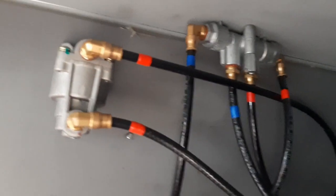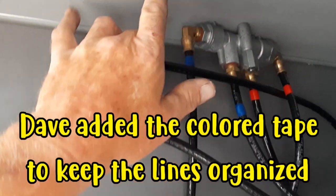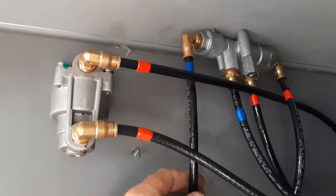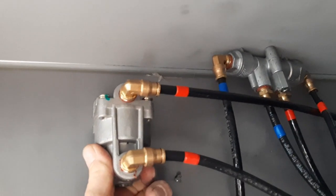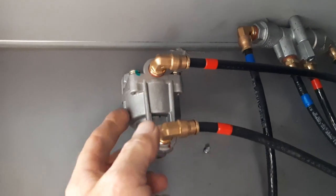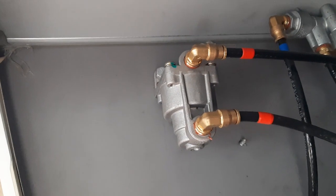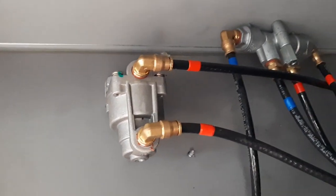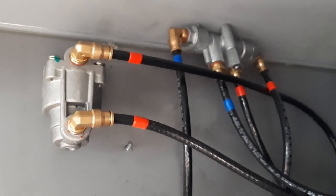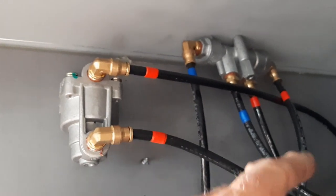I installed the valve up here, bolted to the top. What did you have to buy separately? I had to buy this valve separately — that other one comes with the kit. This valve drops the air pressure down to 90 pounds or so for the Kodiak disc brakes. If you have drum brakes, you don't need this valve. So I put that in.